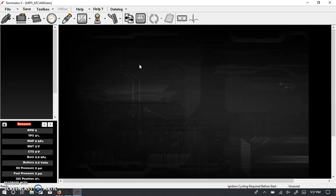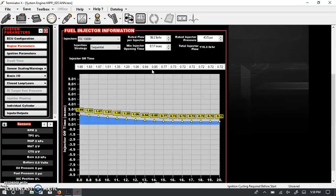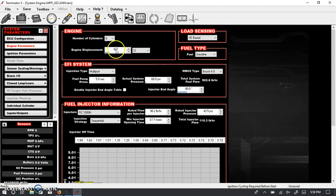The other thing I want to cover in this video is the system ICF, which is sort of the core. I'm trying to keep these videos relatively short — please put your comments below and I'll be glad to make more. Looking at the basic system ICF, the tune that was loaded is a pre-canned tune from Holley. It looks like a naturally aspirated setup — 427 cubic inches. Here's where you specify what sort of fuel control strategy is going to be used; in this case it was VE-based.